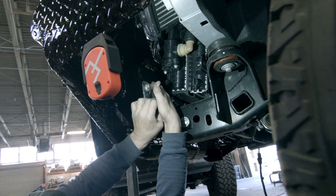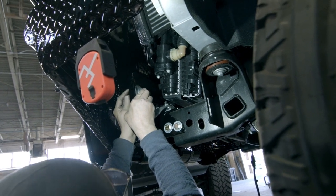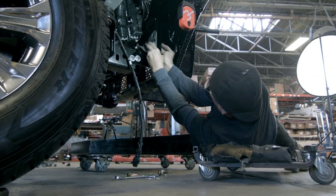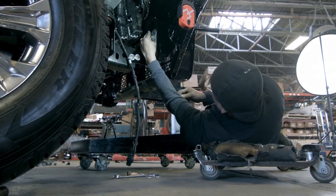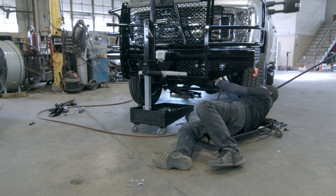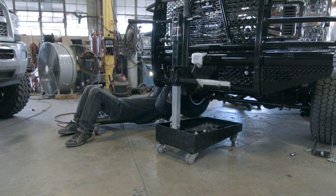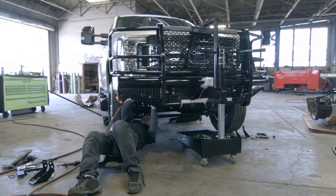Bolt the bumper onto the mounting bracket you have just installed, using a washer on both sides. You may have to use a hand ratchet instead of an impact wrench on the inside brackets. Tighten the bolts down almost like you would a tire, moving from one to the next and then back to the first bolt again to ensure a tight fit. Before the bumper is completely tightened down, double check that it's level and not obstructing your headlights. You want the bumper to be half inch to three quarter inch below the fender. Tighten these down as much as possible — this is the primary support system holding your bumper. You should now be able to remove your stand or floor jack.